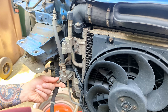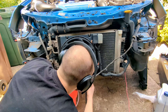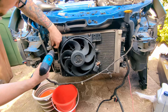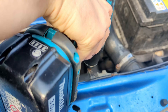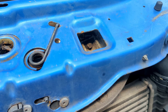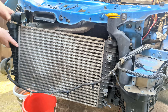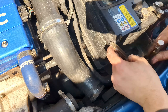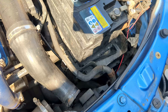The AC rad has to be removed for both the AC delete and to replace the radiator and intercooler, so first both lines are disconnected, then the AC wiring loom is unplugged from the sensors, the compressor and the AC fan, then there's just four screws holding on the AC rad. With the aircon rad out of the way, it's time to take off the intercooler starting with the boost hoses at the top. There's a little screw under the slam panel holding the top boost pipe onto the radiator. I disconnected the rubber pipe from the metal boost pipe, allowing me to lift the intercooler out leaving the metal boost pipe in place. Finally the three coolant hoses on the radiator can be removed and with the top radiator mounts unbolted, the radiator should just lift out.